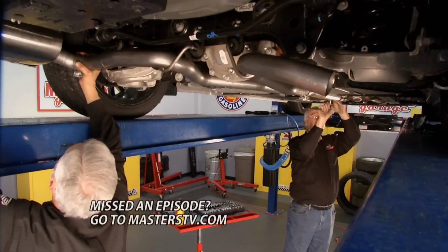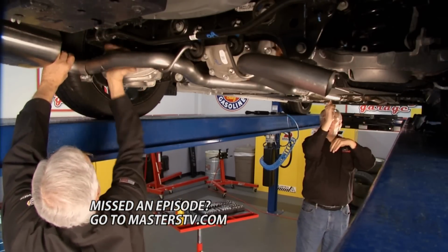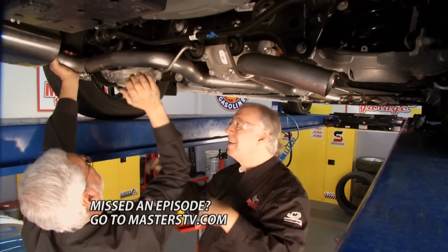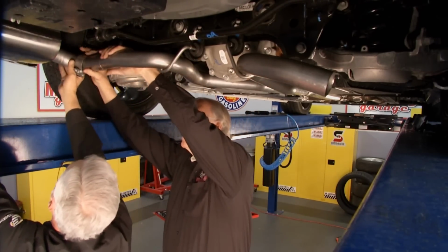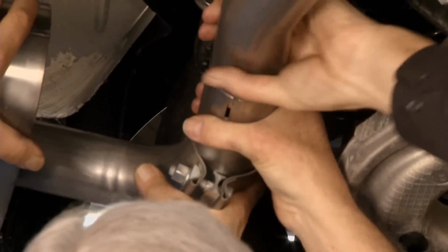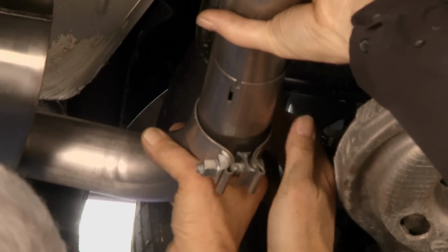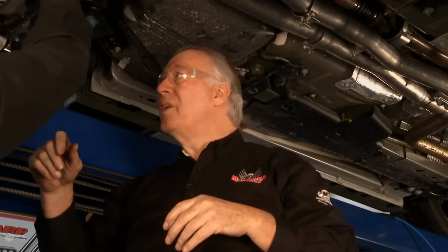I have to come forward just a little bit. I'm gonna need your help over here, big boy. You need my help? Yeah, I hate to admit that, but I do. What do you need here? We gotta put a little bit of an angle there. Yeah, I tell you what. You gotta push this in. You gotta push this way. There we go. Now, the trick on this is when you put all this stuff up, you want to leave it all loose. You don't want to tighten anything up until you get everything mounted. Then you can go ahead, put it together, tighten it up, and you'll be all right.